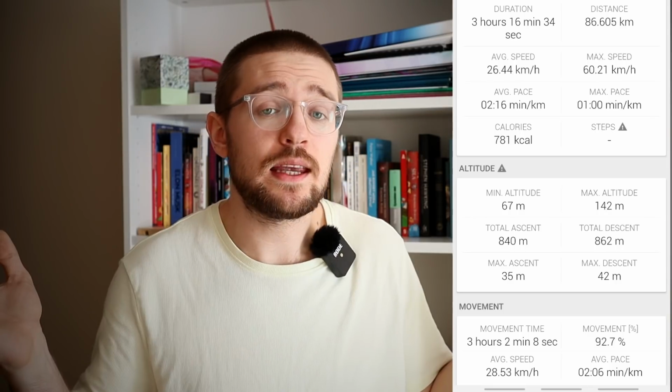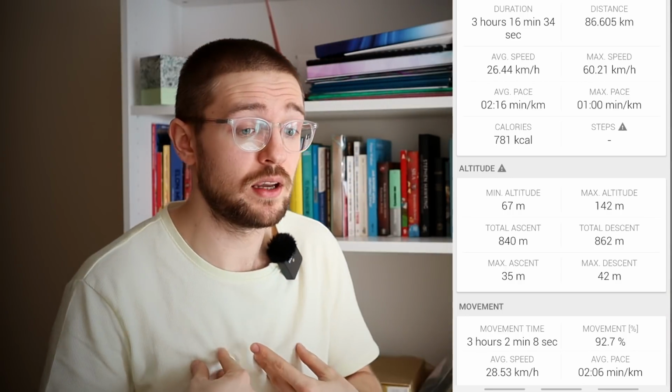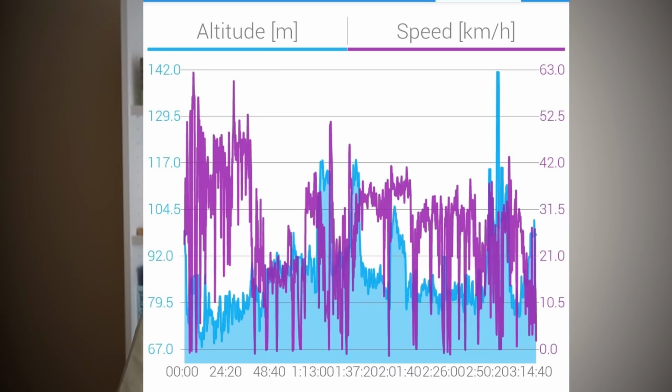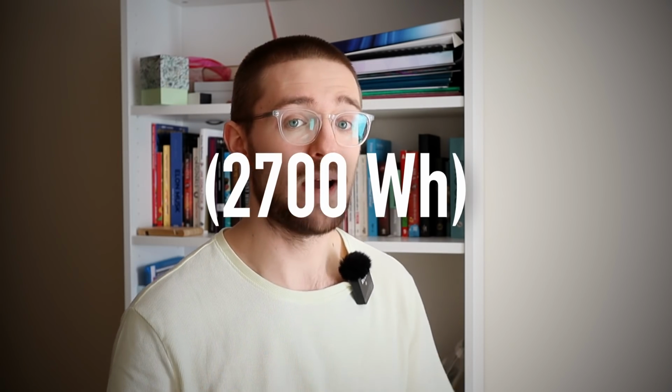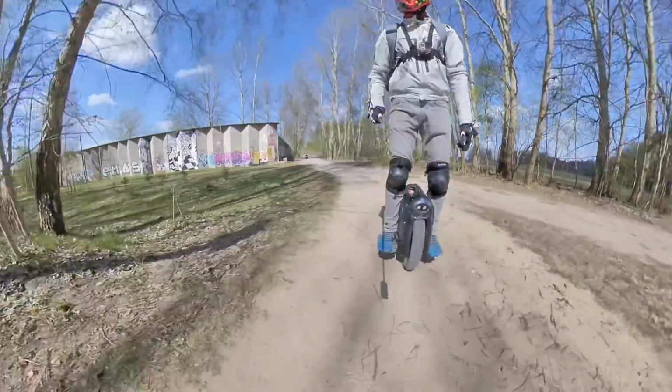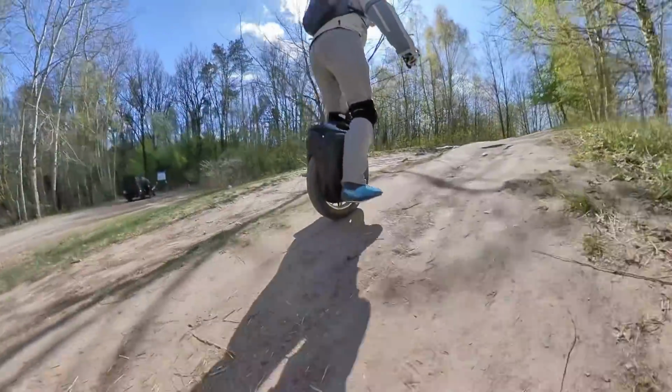And I gotta say to you guys, I did the range test. I did around 87 kilometers or 89 via EUC World. It's insane. Hands down, with my style of driving, the only vehicle on my channel without any pedal assist and so on that could do a range above 90 kilometers is the Dualtron X with a 60 volt 45 amp hour battery pack. And I was specifically driving this thing really slowly and carefully to get this maximum range out of the scooter. Again, the range here is insane, and I think if you have a wheel that is 1600 watt hours or you have 1 kilowatt hour and you want to get way more range out of it, this is the way to go.